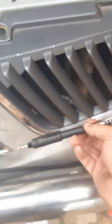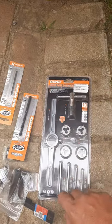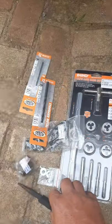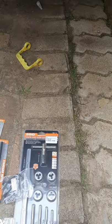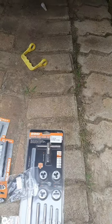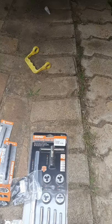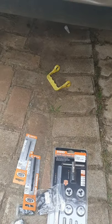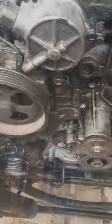This is what it looked like - it just broke off right there. I went to the store this morning and bought a tap and die set, two drill bits, a couple of bolts, and a center punch. My plan is to grind it off until it's flush with the pulley, then drill it, tap it to M8, and then insert a bolt with some Loctite and a flat and spring washer. Let's hope it works.